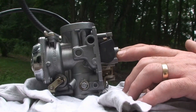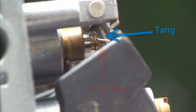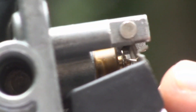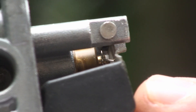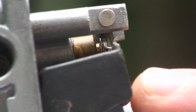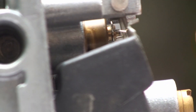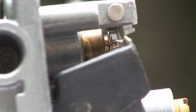If you can see, when I push on the floats, it's actually going to start to depress that pin. Right now I just have it resting on the spring-loaded pin, and if I push on the floats, you can see it's moving the pin. And when I let go of it, the pin is fully extended, but the tang is just resting on it.